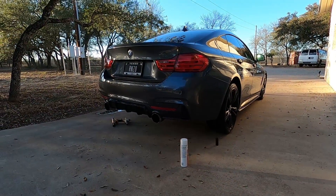If you've never used one of those rubber wheel removers before - they told me at the store and I've heard it before - don't stay in the same spot or it's going to burn through your paint. I've never had that issue, but if this is the first time you use it and something happens, don't be mad at me. Be careful because it does get really hot. If you sit in the same spot too long it'll probably eat through your paint, so just make sure you're being smooth with it.